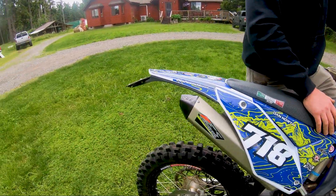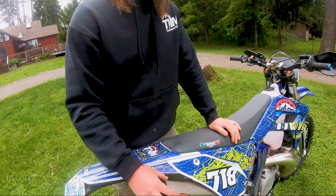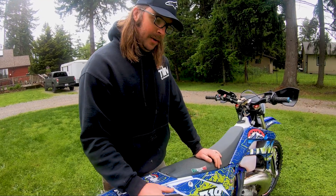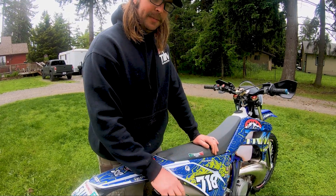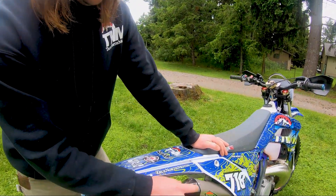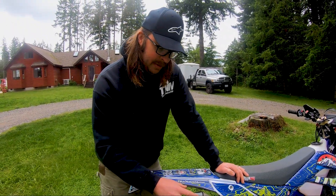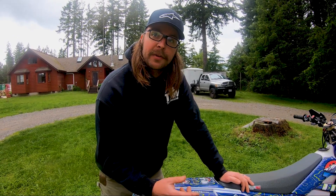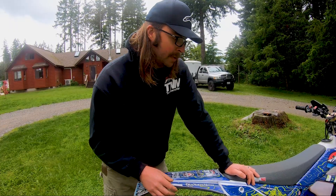Is that the factory can? This is a factory can. I did miss that one — I did the Enduro Engineering end cap on it. The only other exhaust available that I could find was the FMF 2.1. My only gripe with that one is it's really big — it's almost like a four stroke muffler size. I usually like to run the FMF 2.0, but they don't make it for this bike. If you ever run one of these Enduro Engineering or Fastway end caps — or whatever one you get that has a screen — word of advice: after you wash your bike, take a little propane torch or map gas torch and burn the carbon off the screen in the end cap, because if it clogs up it'll make your bike run like crap. Every time I wash my bike it takes about 20 seconds and I just burn the carbon off that screen. So a little trick.